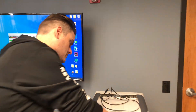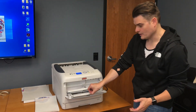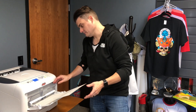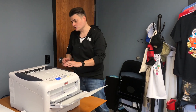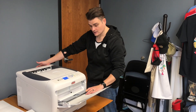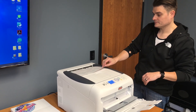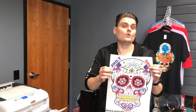This is your multi-purpose tray right here — see how it comes out. You can put big or small paper in. How you feed the big A3 paper is only one way: short edge, just like this. You put it in and close it. With the OKI 8432 there are two ways: you can either have the back of the printer open or closed. Either way, the paper comes out either through the back or through the top. We have the back closed, so the paper is going to come out through the top — just like that. That's how you print with the Space Control software using the OKI 8432.